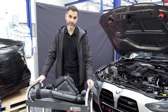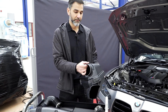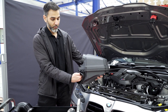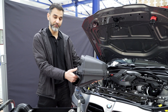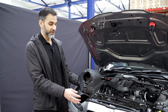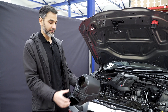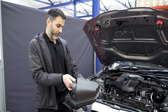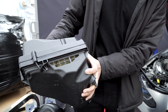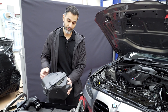I've removed the stock airbox system from the car. Let's have a quick look at the stock airboxes and tubes. This is from the right side of the car as seen from the engine bay. Cold air is fed from the duct which pulls it in, and you've got your output from the top. There's a panel filter inside — a typical paper panel filter, not huge in size. The outlet looks like a good size on the airbox. There's an opening in the back of the airbox to relieve possibly some excess pressure building up inside.